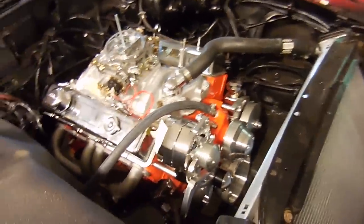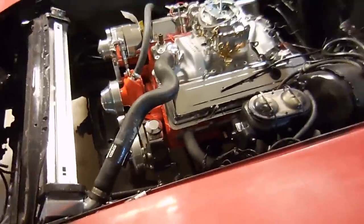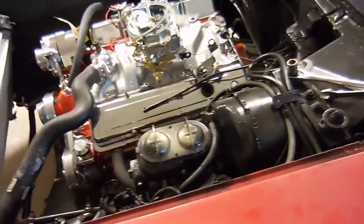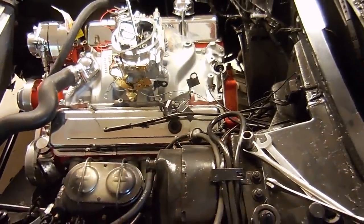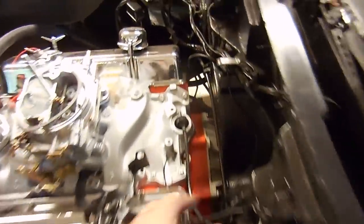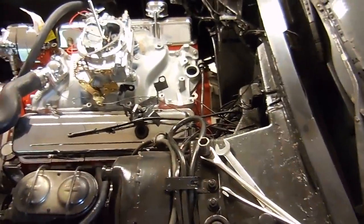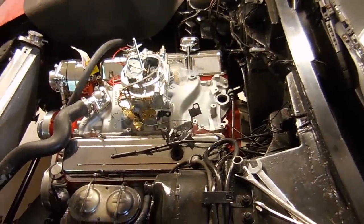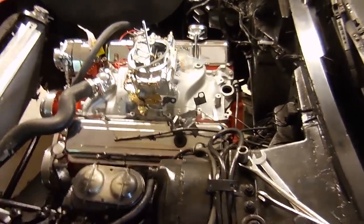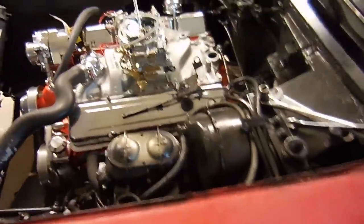In the mail I'm waiting for the serpentine belts, but in the meantime there's a lot of stuff I can do. I have finished the cooling system with the exception of one heater hose, which I plan on doing today. Next I'm going to work on the oil system - I have to prime this motor since it's never been run before. I need to make sure this oil fitting is connected to this oil line so there's no oil leak. Then I have a priming tool that I'll use for the distributor - I'll turn the motor a quarter turn, run it, turn the motor a quarter turn, that way it gets everything lubed up and ready to break in.